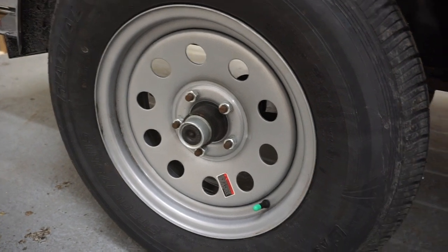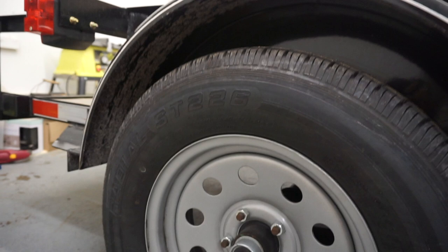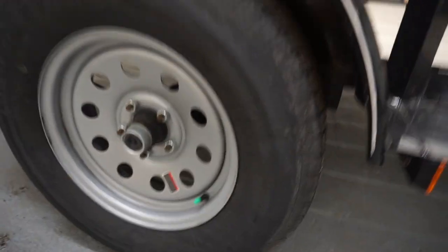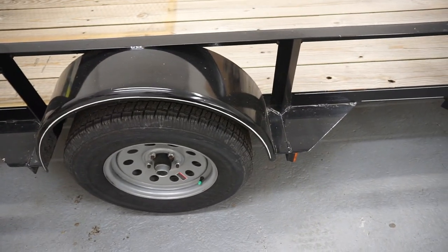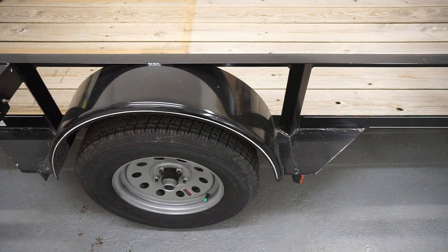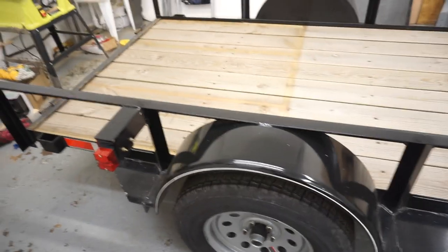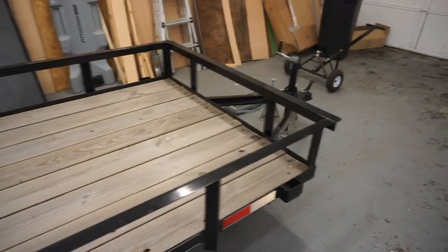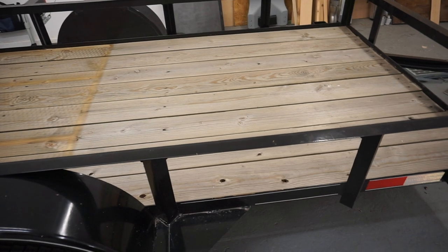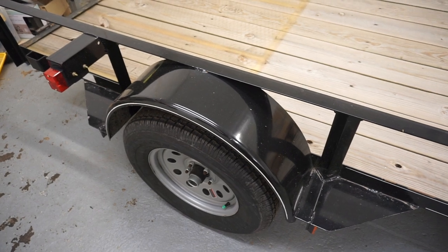That's total weight. The trailer itself, minus the back deck — that ramp that people drive their lawn mowers and ATVs up — which weighs about 100 pounds, this trailer probably weighs in at around 700 or 800 pounds. That leaves you about 2,300 pounds of capacity to build on top of it. You're probably not going to need all that capacity, but it's good to have, and you definitely don't want to max out the rating on a trailer or an axle.